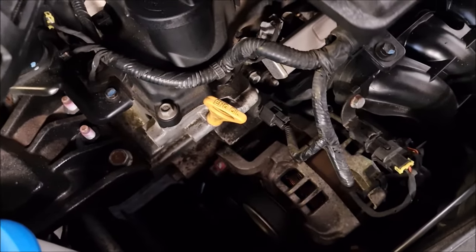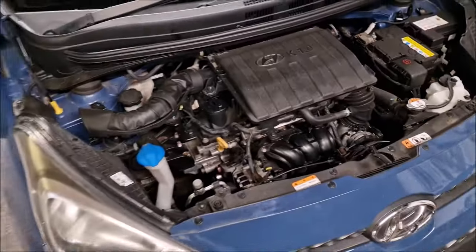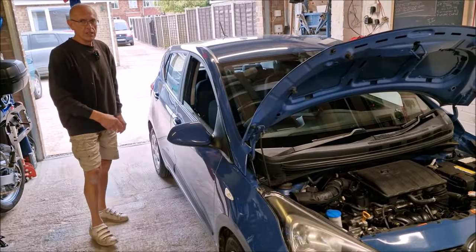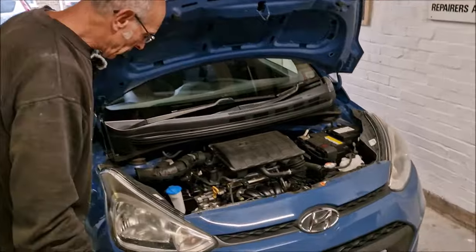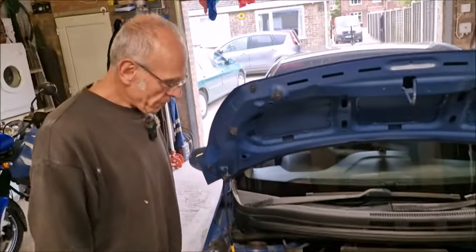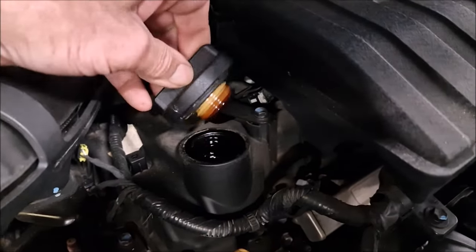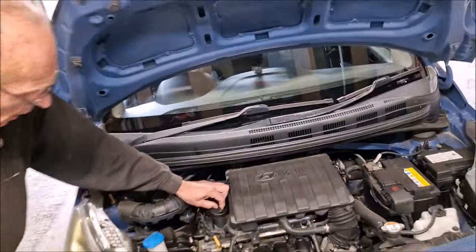But you take the belt off and it still does it. So I can hear a chunk, chunk, chunk, chunk noise. Yeah, it's got worse, actually. When you first heard it, you swore that was a belt. Now it does sound mechanical. So that noise that we can hear, you can't hear it through there, we think is the timing chain. I hope it is.